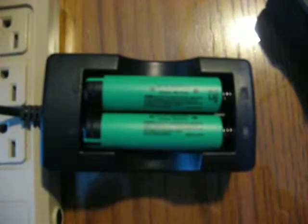This is the bad charger. It just blinks red on and off, and it does not charge. This is a wattmeter — it should be somewhere around 6 watts of power. You can see here it's really not doing anything: 0.4 watts, 0 watts.